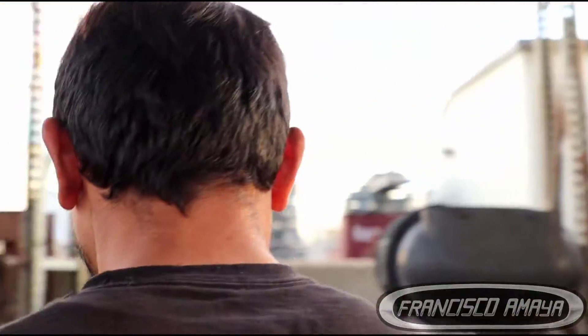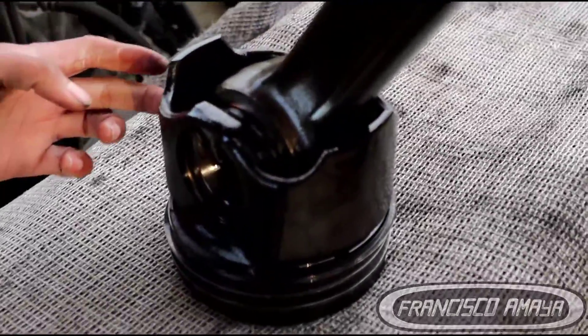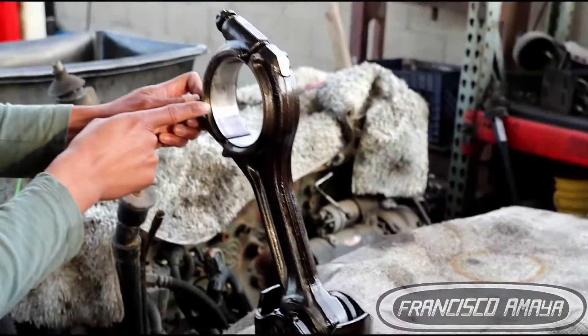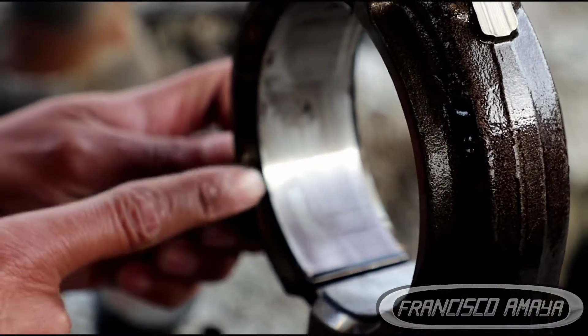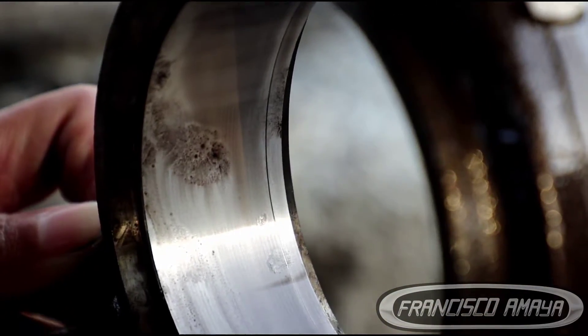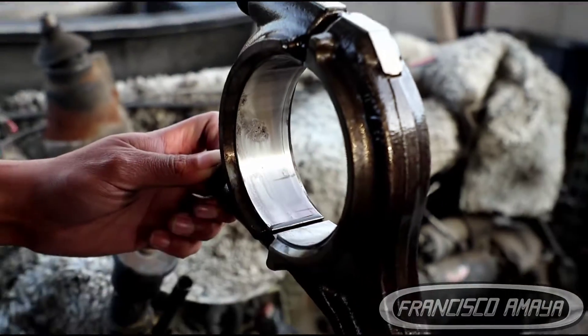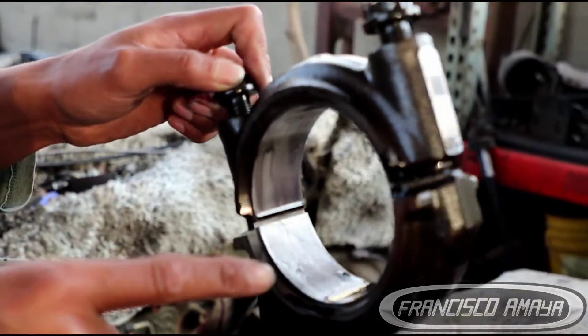This seal leaking is a contributing reason why we were getting coolant on top of the gasket, creating the corrosion we can appreciate on the top of the engine block and cylinders. In this case the piston right here doesn't present any damage. We can see the bearings and the bearings are in good condition — we can see a little scratch that goes across the bearing, but that is probably because something went in and scratched it. After that there is no other damage present on the bearing.